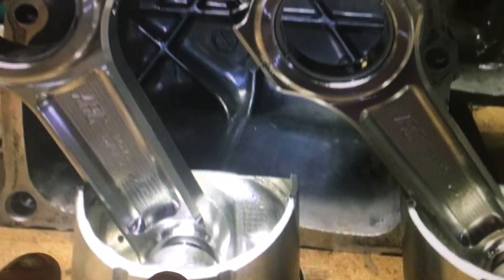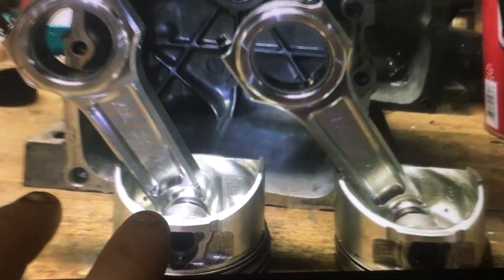These are the connecting rods that are in this engine — part number 6273 or 6275, it's hard to tell from the picture. They're ARC billet aluminum connecting rods and they have replaceable roll-in style bearings, like your car engine or the bigger Onans, like that Onan T260G down there.